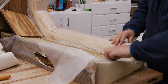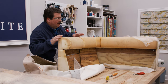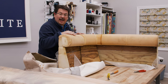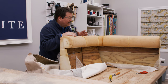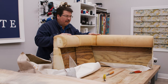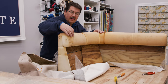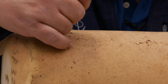It's not totally waterlogged. Okay, after we take the silk film off, we need to inspect the foam and see if it's worth being replaced. It would save some money not to replace it, and it would save a lot of labor as well. But this foam doesn't look to be in terrible shape. What you want to look for is major black spots or mold. And there is some over here. Actually, a closer look at this, and this is actually just dirt.